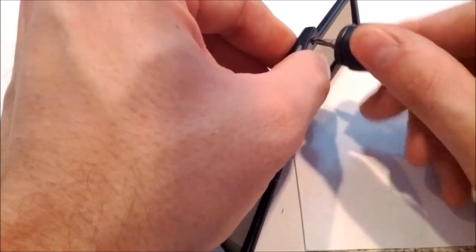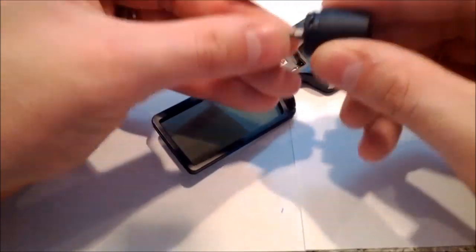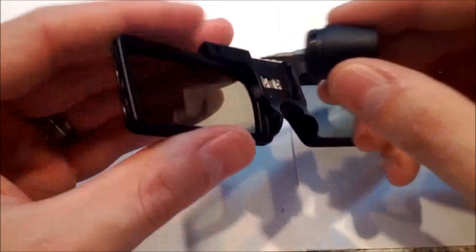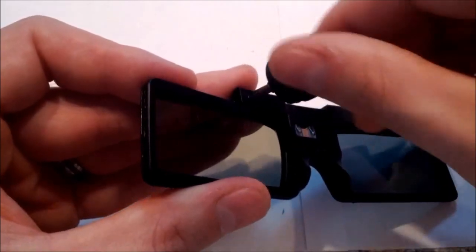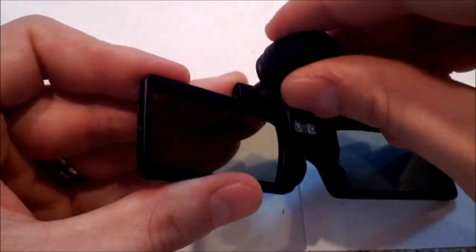Like I said, when you push the button, if it blinks and flashes red, green, red, green, red, green, that means that you have a short somewhere, or one of your wires has become broken and no longer makes a connection. So make sure you test it before you glue it. That way you can take it back apart much easier and fix the problem.